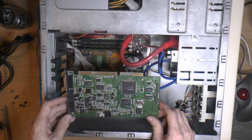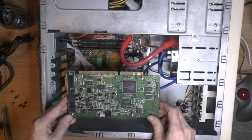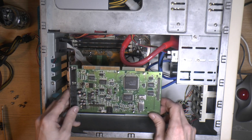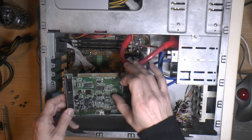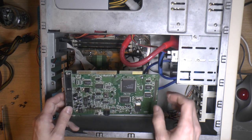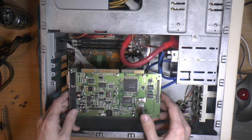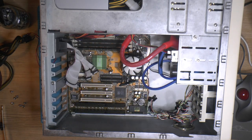The sound card we're going to reuse — it's from my old Pentium 166 back in 1996. That's a long time ago, and I had it in my K6-II system. I also tried a Creative Live, but due to the EMU10K bug with the PCI on the MVP-3 chipset, it didn't work well, so I'm not going to try that again.